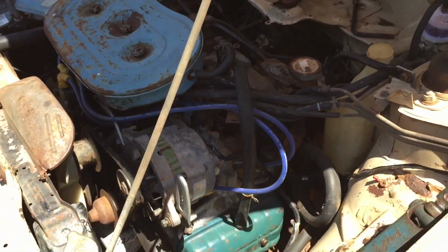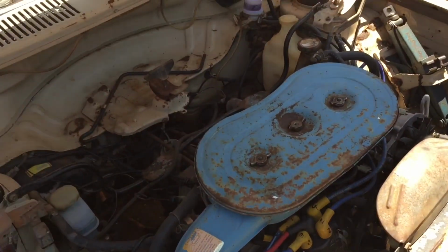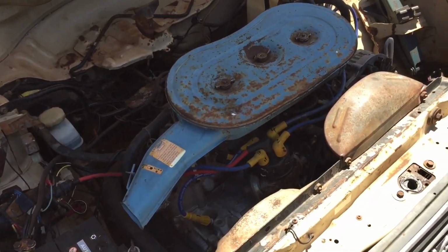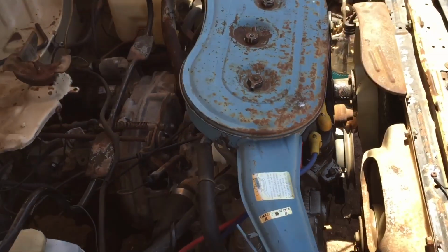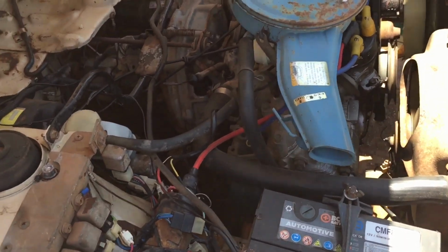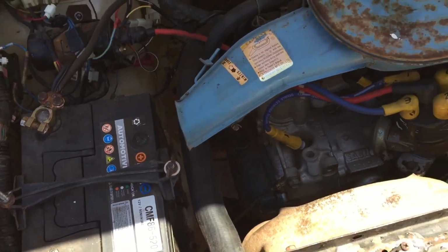Oh, this thing leaks oil too. I think it's leaking from the front main seal. But oddly enough, I check the oil every time before I start it. Oil's always perfectly full. Even after I run it for a while, let it sit for a couple hours and check the oil, oil is perfectly full. So I don't know how this thing's generating oil. It's not putting fuel into the oil. I already did the sniff test and the fuel test, and it's perfectly fine. So, I don't know. Maybe it's my imagination, or maybe it's not a bad leak, and I'm not going to worry about it.